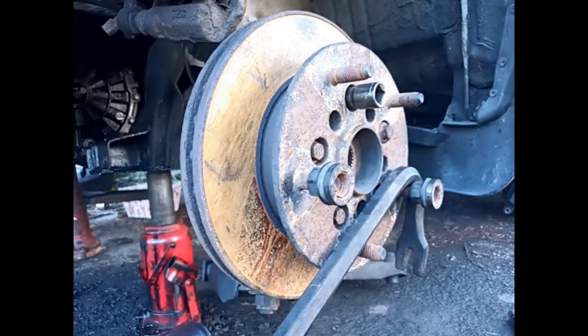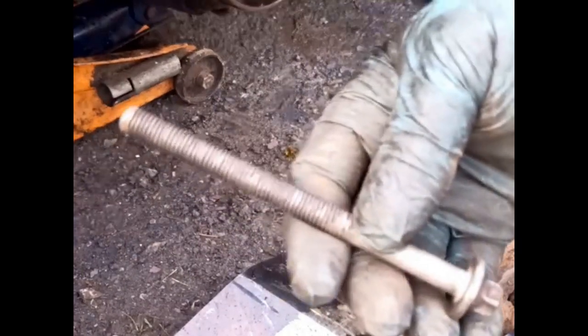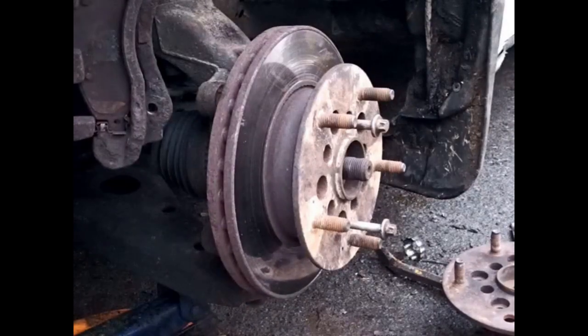Grand. I got these off the Corsa, off some aluminium brackets on the front of the engine that holds the alternator and things like that. They're Torx heads, but a spanner fits those. This is an M10, standard M10 thread. It's about 75mm long, and I know that these are high tensile, which means they're not going to strip and cause me problems. We've got our bolts in place.